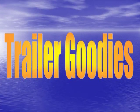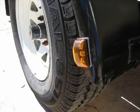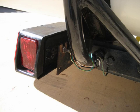Now just a few modifications for the trailer. Save time and make it safer by adding LED lights to the trailer. By having multiple bulbs with LEDs, your trailer is never left in the dark. By soldering and using shrink wrap on the wires, you no longer have to disconnect your trailer lights when the trailer goes in the water — your lights are waterproof.